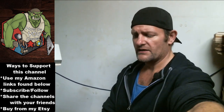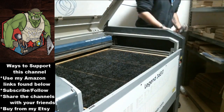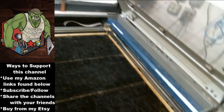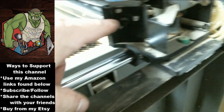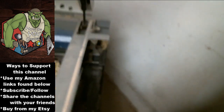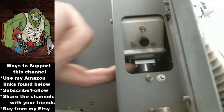Step one: you want to be able to access the inside of your panel right here, so we're going to take all of these screws out. When you're talking about the alignment, you have a few different spots that you start tinkering with. If it's not real bad out of whack, you're going to use these three screws right here on this mirror housing. There are three more right here that you'll use every now and then, but they very rarely get out of whack. In addition, there's actually a set all the way down here inside, and these like to get loose every now and then, which is a pain.